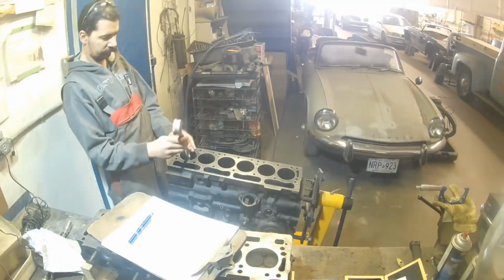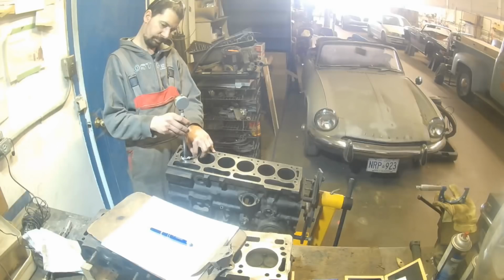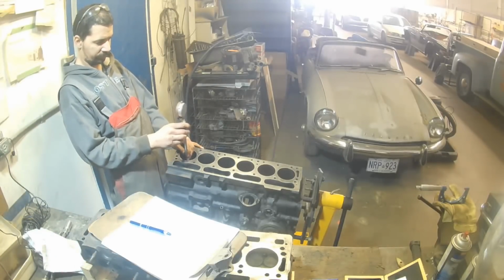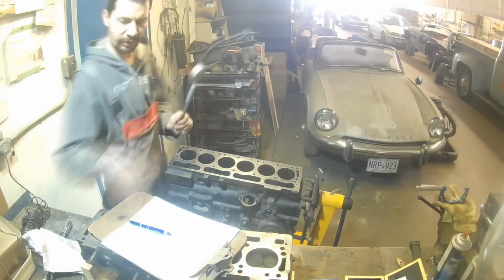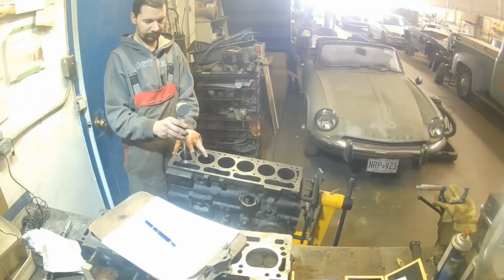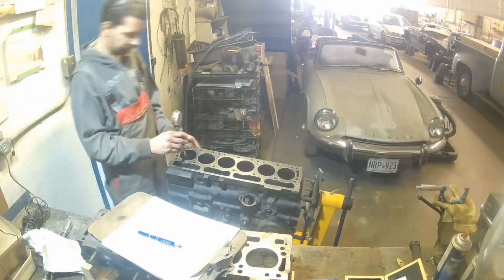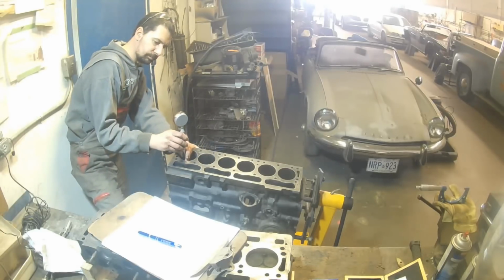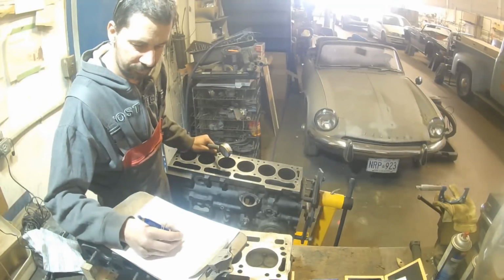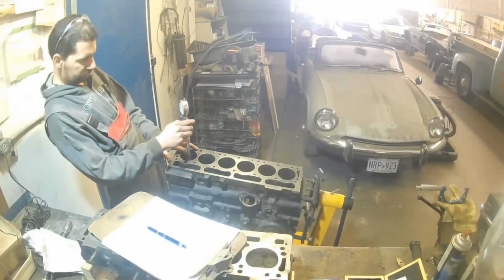Obviously the cylinders were rebored recently, or recently kilometer-wise I mean, because I could see that .010 pistons were fitted, and I measured all the cylinders for out of round, for taper and for size, and all of them measured very well. Out of round and taper were all within tolerances, and the only thing was that the number 6 cylinder was a little bit bigger than all the rest of the cylinders. It was still within the tolerance for .010 oversized pistons, but just a little bit bigger than the other cylinders. So what I wanted to do was also to measure all the pistons and find the biggest one of them and put it in number 6 cylinder. With that, everything was gonna be okay.